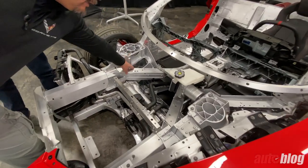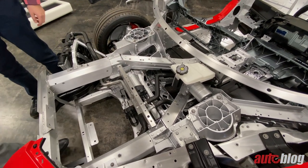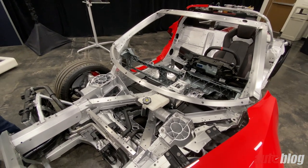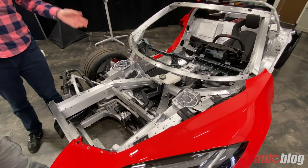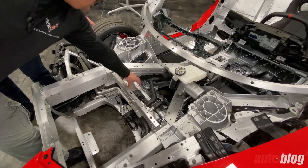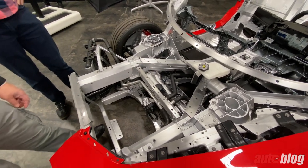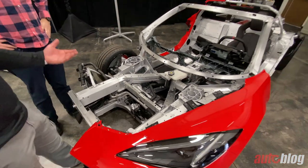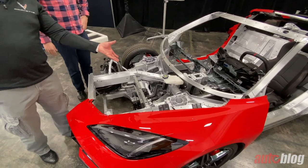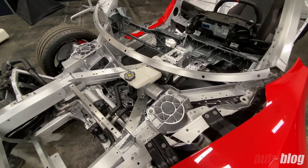There are provisions in the structure for right-hand drive, so you flip the steering wheel over and reposition the interior components to end up with a right-hand drive version. This is electric power steering — specifically called an APA, or parallel axis electric power steering. The e-boost module is present in this entire configuration.